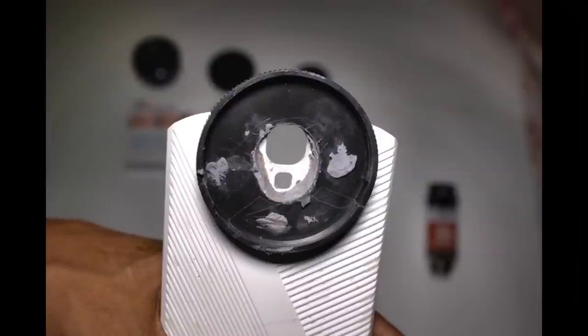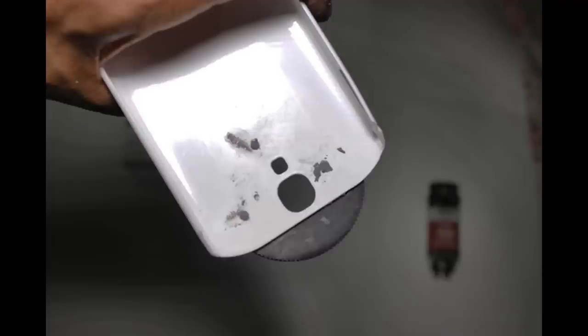Quickly screw the lens on the cap, then place and center the lens cap with the case, making sure that the center of the lens cap lands exactly where the center of the camera is, and then press gently to ensure that the epoxy goes through the holes on both the cap and phone or tablet case. Quickly rub off epoxy from the inside of the phone or tablet case, making it even with the surface, because if not, it will scratch your tablet in the future. Place down and let dry overnight.